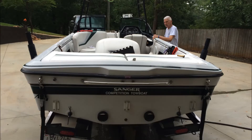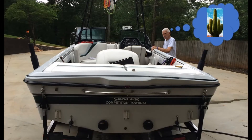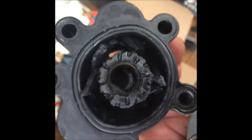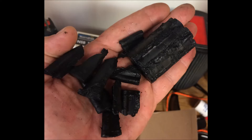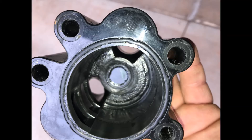Here you'll see in the photo that my dad is giving me a dirty look because he's helping me with the water pump impeller instead of going out in the boat. The next series of photos shows the damage that occurred as a result of running this impeller for too long. The blades on the impeller completely disintegrated off the impeller. You'll see that they caused damage within the housing — there was nothing left, no water flow whatsoever.